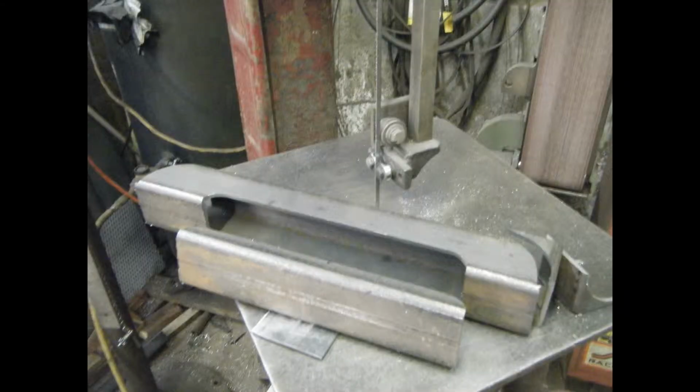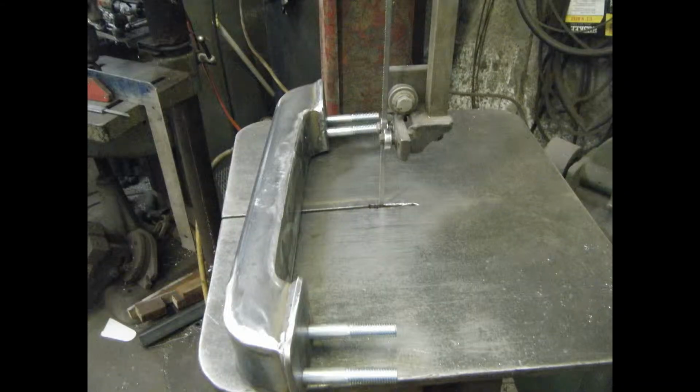This has the truck pan on it still. You can see it still sticks down below the cross member. The factory cross member used to go through the middle here from one side to the other. And I made this U shape. This is a 3/16 wall. It was 2x2 box tubing that I cut the notch out of. You'll see some pictures of that later. I cut the notch out of it, and then to protect the pan in case I got close to bottoming out, I put this really strong piece on it, but you can see the shape of that cross member that I fabricated.